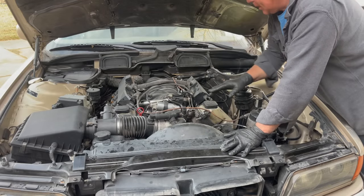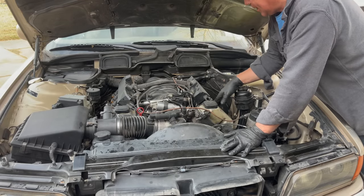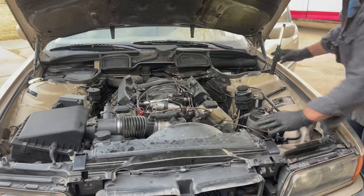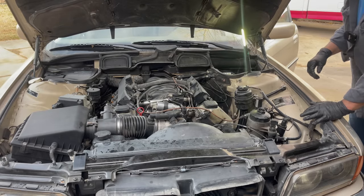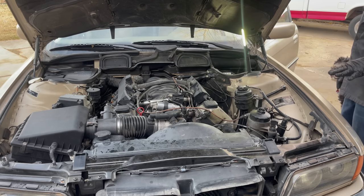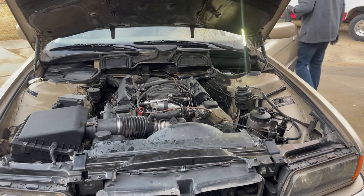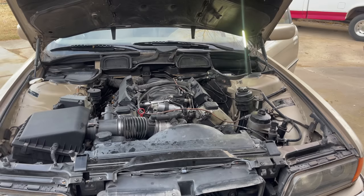We have the throttle cables, everything's connected. We have the coils connected to the packs that are connected to the fuel injectors, and I think we're good. I even have a fancy light to make sure that you can see how this car performs, because she's gonna start, I hope. Are you ready? This is it. Without further ado, without further interruptions from Lola, please start. And if you don't start, I'm gonna jumper the fuel relay and force fuel down your throat. Here we go.